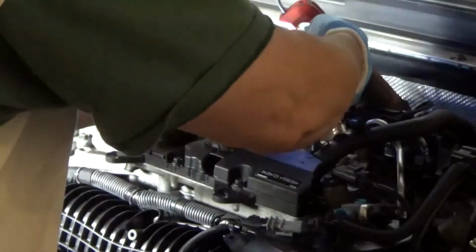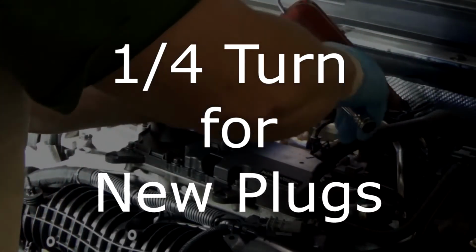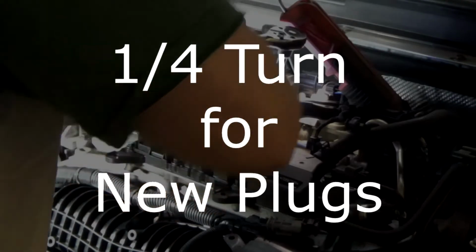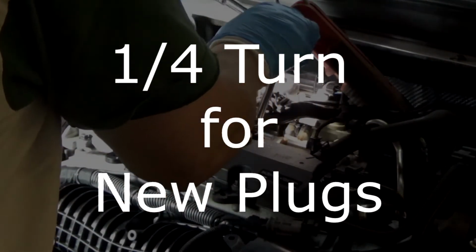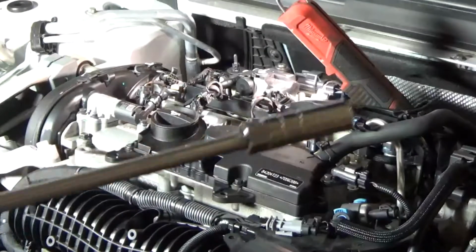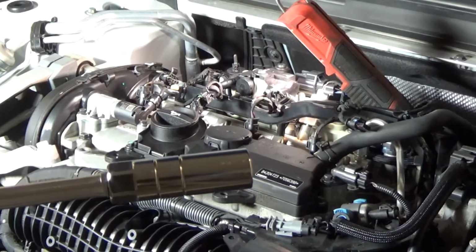There were no instructions on the spark plug. NGK says like half a turn for new plugs and a quarter for used plugs. Let's see if I can get a half a turn on here. Yep, sure can. And out comes the spark plug socket, and the paper should be down there. I'm going to go fish it out.